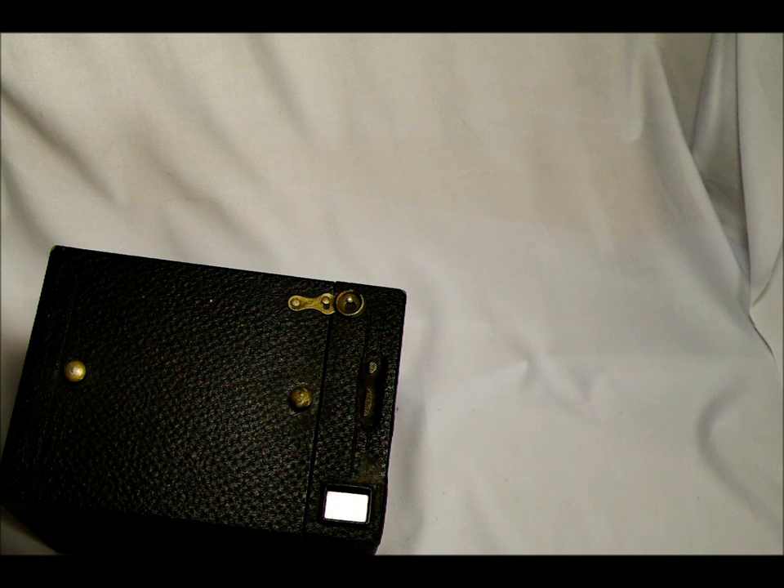And that's really all there is to this camera. There were three different shutter speeds for the Kodak Brownie No. 3 Model B: there was 1/35th or 1/40th in that range, 1/45th, and 1/50th. And there were designations — F for 1/50th, a dot for 1/45th, and S for 1/35th or 1/40th.